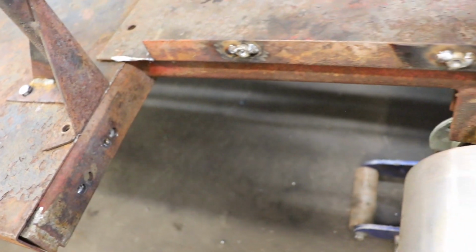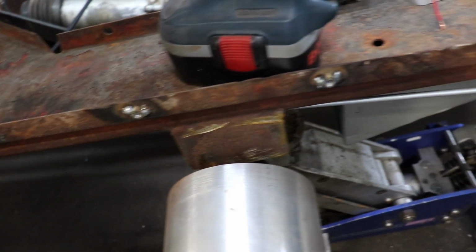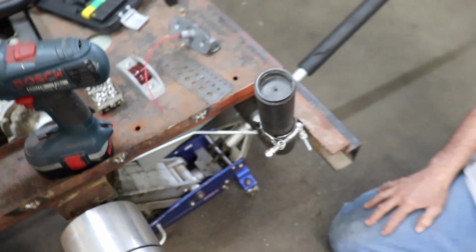So just about anything that's being bolted down on this thing, if it's got nuts on the other side, if it's not thick enough to thread or thick enough to put a Nutsert in, then I'm gonna weld nuts on the backside or use the Nutsert. So you're probably wondering, oh, I never seen that Nutsert tool, Taryl. Tell us more about it.